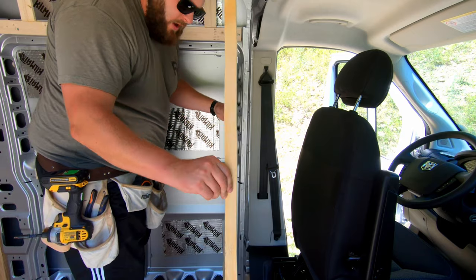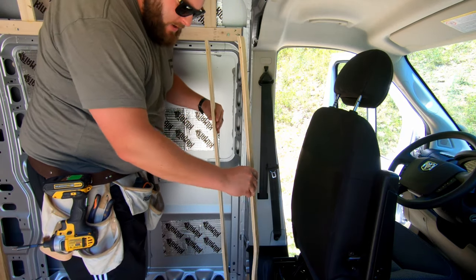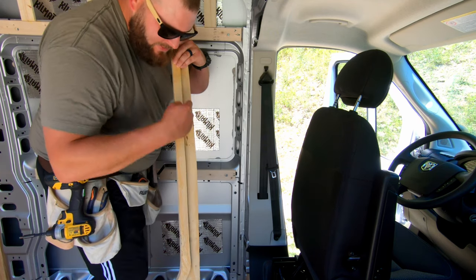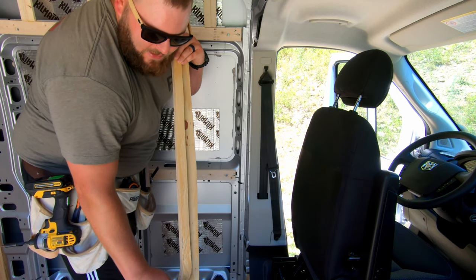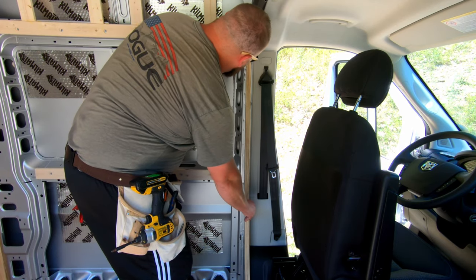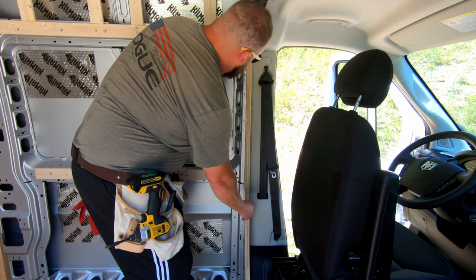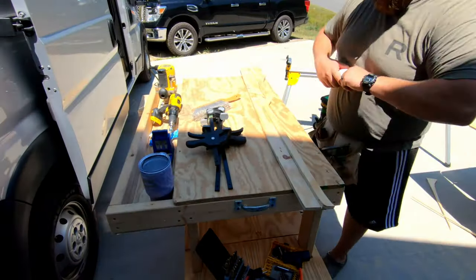To be continued. So I just traced this piece here, made like a 1 incher to go right along with it. So if I hold that here, I still have room for a furring strip behind this to tack to. This will get glued down and covered in carpet. And then when this goes on with the gap, you see how that gets closed nice and tight. Let me get my big head out of the way here. This is gonna clean up really nice.